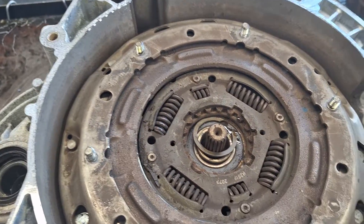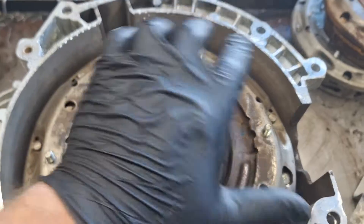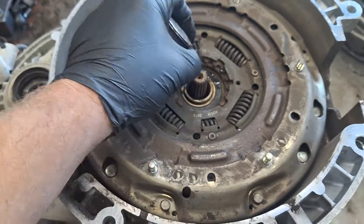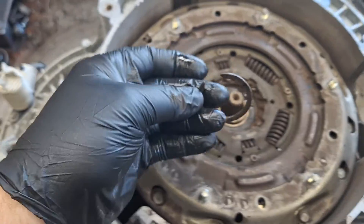The reason I don't hammer it with the special tool first, or use that giant monstrosity that presses down on it, is because when you hammer it down it knocks a bunch of dust down in the bell housing and you've got to clean all that out. I can just as easily pop it out.